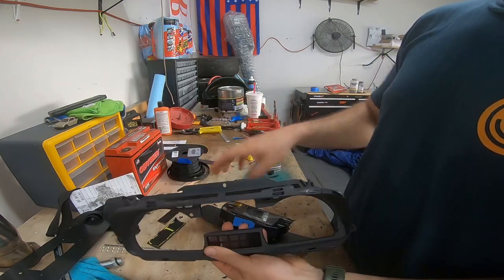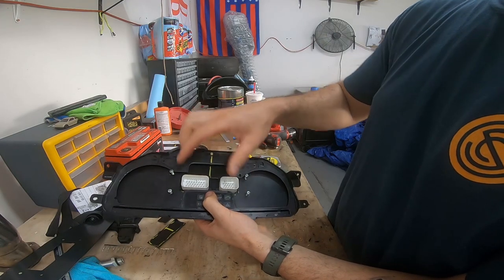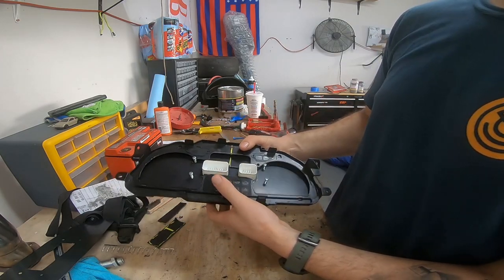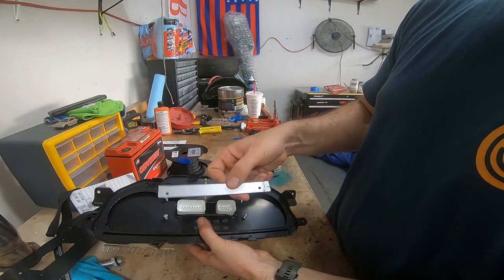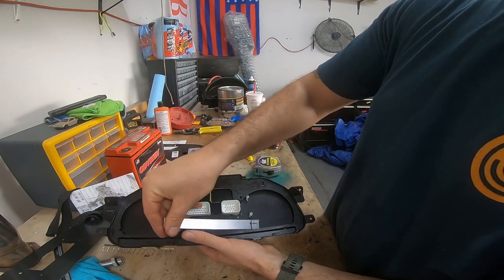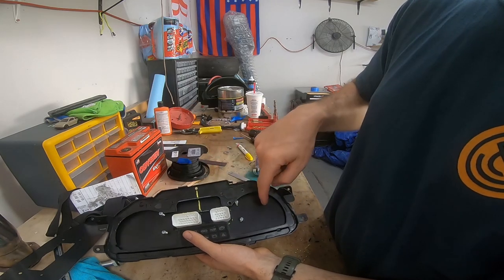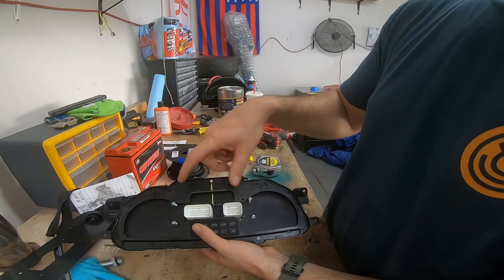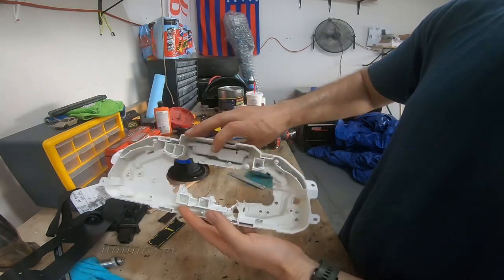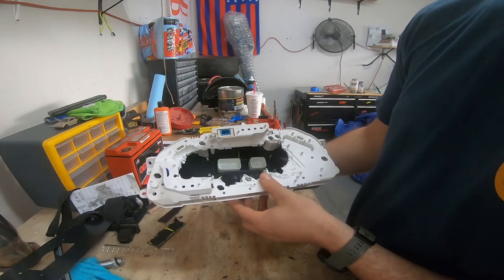Essentially you have to cut some of this stuff out here - you lay this on here and I had to basically just cut out enough of this so the connectors could slide through. Now nothing's going to clamp onto this so this isn't holding into the housing. The idea - what I'm going to do - is some strap aluminum, basically a bar right here, is going to bolt and overlay here. This will kind of attach to keep it to the back of this cluster, and similarly attach the two top points. That way it essentially affixes the cluster or the dash to this black plastic and to this housing so the housing can snap back in. I already dremeled it - look at that monstrosity - it's all dremeled out. So when this gets connected again, I can still actually have access to unplugging it and unscrewing it if I need to.